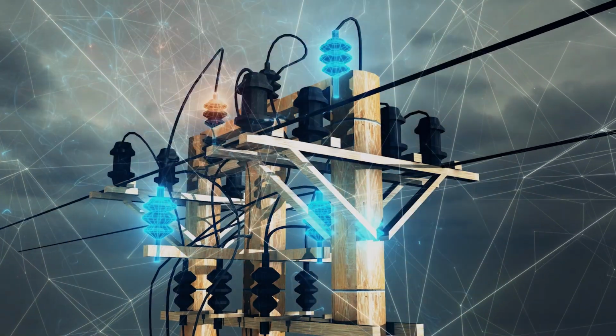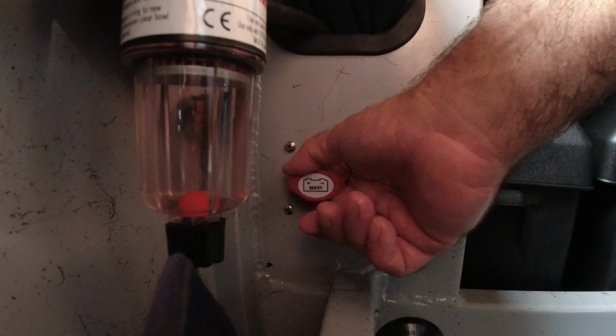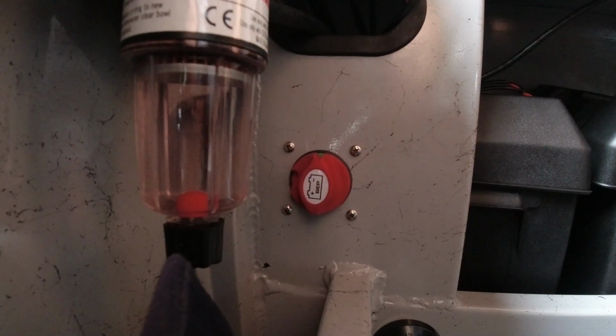But more importantly, the electrolysis that is caused from the battery running through to the engine in particular and other electronics can really cause a lot of corrosion issues in your boat. Now, you can get an electronic leak somewhere, for want of a better term, but what that is is when some wiring is in contact with the boat, it'll start to earth itself off on the boat, and that'll create a lot of corrosion, a lot of electrolysis. And electrolysis is really important with engine shafts and stuff as well. So turn that isolating switch off and you'll save yourself a lot of issues with electrolysis later on.